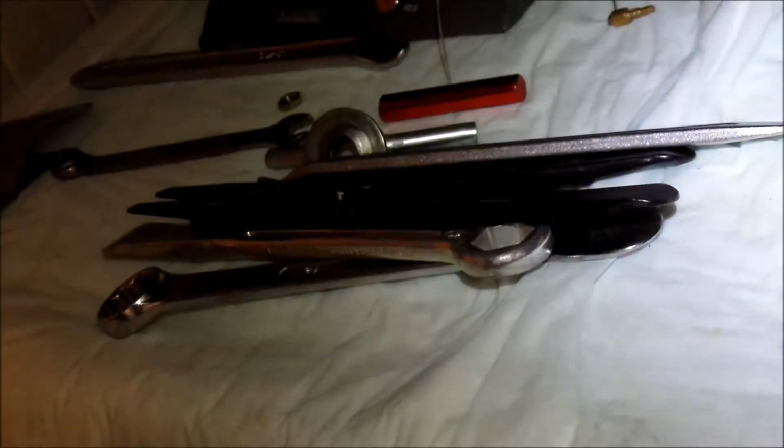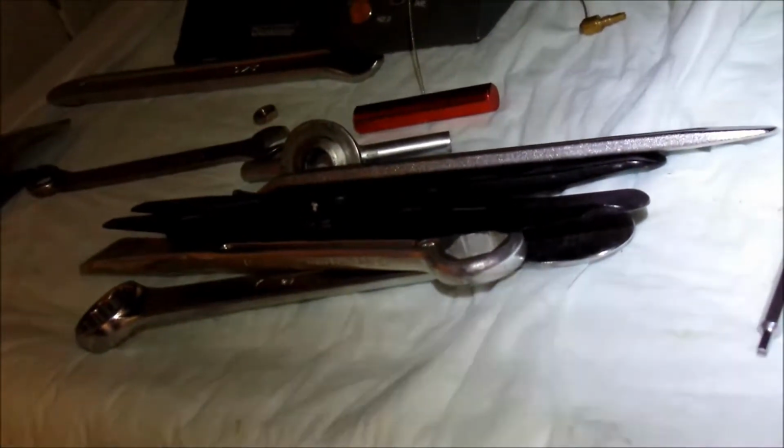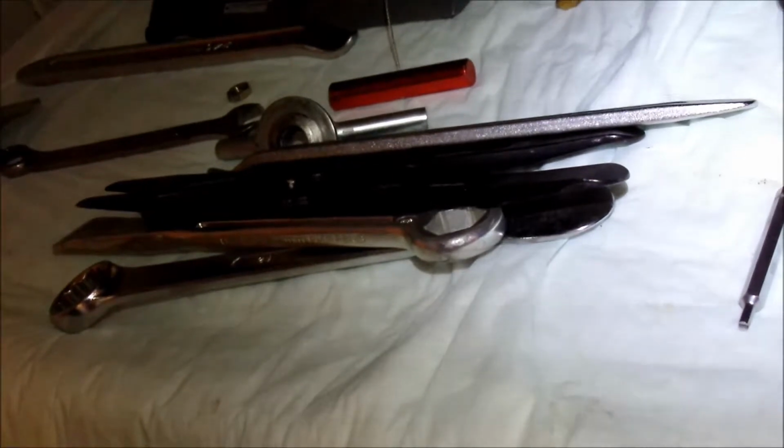Actually, what I used was this. See that? The Motion Pro Bead Pros, the black tire levers. Those helped a lot. That's the first time I actually used it to help keep the bead down, kind of like a bead buddy. Of course, I had the bead bunny too. The bead bunny's right there. But this helped me push it down. Usually I use the really big tire lever, and it has a bead pusher on it, that kind of curved section. But I used this one, and that worked pretty good. The only thing is, if you want maximum torque, you got to use both of them.